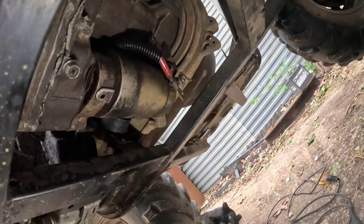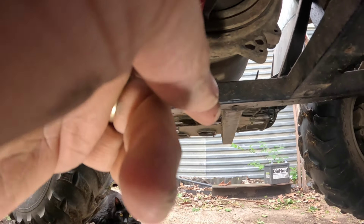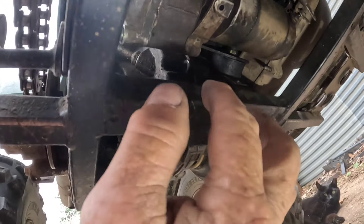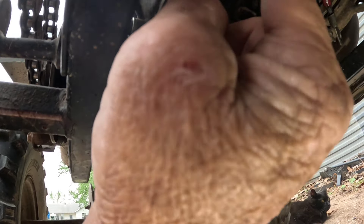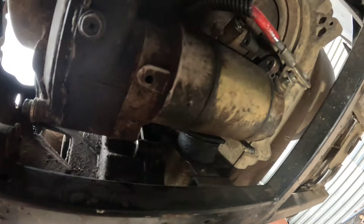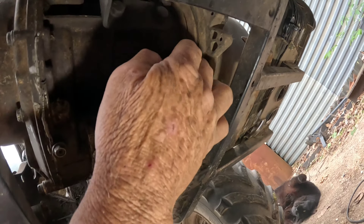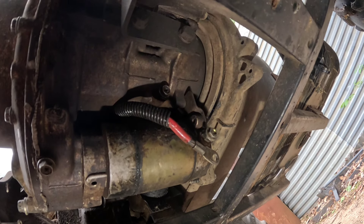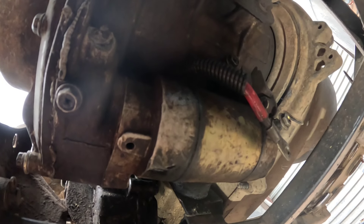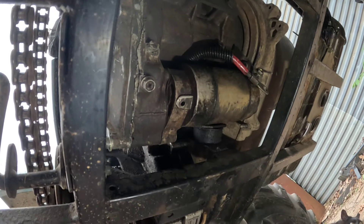Doing some re-recording because my microphone quit on my media mod. I disconnected the battery cable coming down to the starter — 10-millimeter bolt. The starter has one bolt that looks like it comes clear through, and the other one looks like it's inside the starter housing. I'm going to have to probably pull the recoil starter off. On the back end there's a bracket holding it up — feels like a 10-millimeter bolt. I might be able to take that bolt out and just fish it out of there.